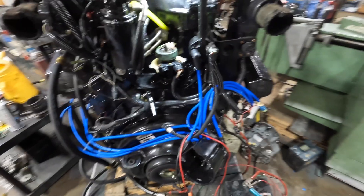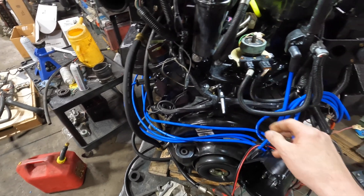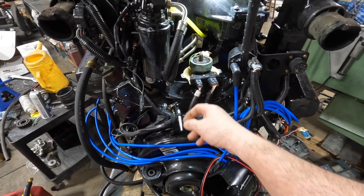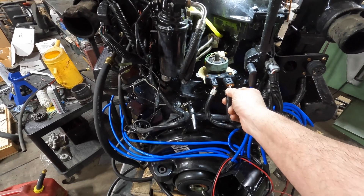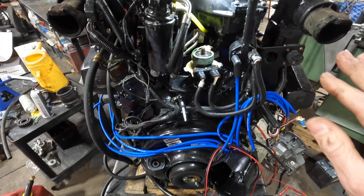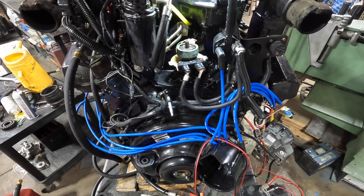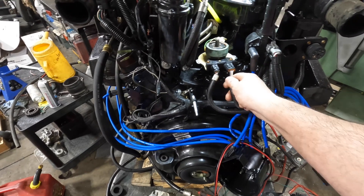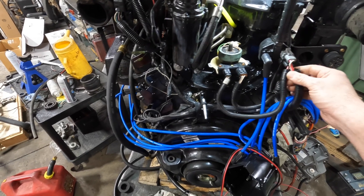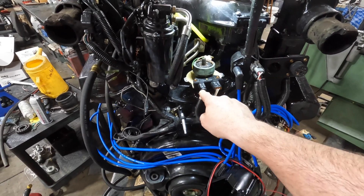Here are the players in the circuit. You've got two connectors in the back of the distributor: the two-wire connector and the four-wire connector. The two-wire connector goes right to the ignition coil. The four-wire connector goes to the ECM if it's fuel-injected. If it's a carbureted engine without ECM input, this will be blank, but you'll still need it to time the engine because you've got to put it in base mode. The red wire is 12 volts and the white is the tach. The other piggyback harness is for the ignition module — it puts power and acts as a coil trigger.